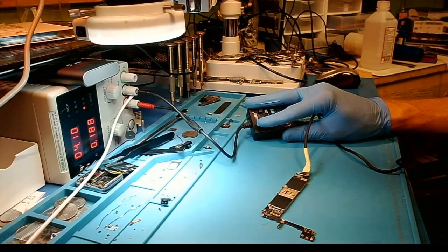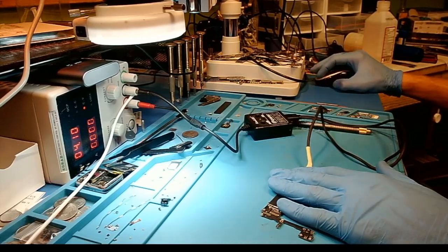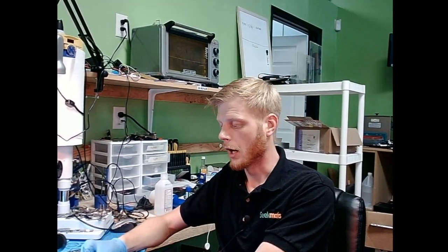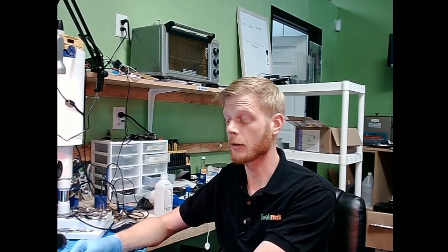We're going to plug in our iPower Max, make sure we have it off while plugging it in. We should have zero current as we turn this on — and we do. Look at that — that's perfect. We'll go ahead and prompt to boot to make sure it's booting normally, and it is. Essentially, instead of pulling it off the board heater as soon as you get one of the chips off, the other one's covered in underfill as well, so the better move would be to continue and remove the NAND next while it's at temperature.